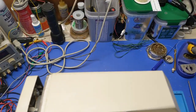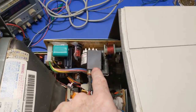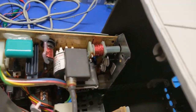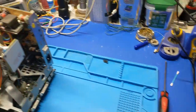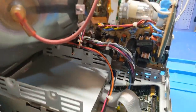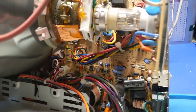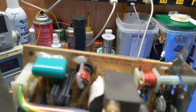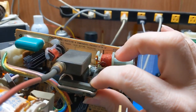Alright, so what do we have in here? It's in fairly good condition. This has the older flyback — unfortunately — so this is an early-run Classic. No surprise: we're missing the hard drive. It looks original though. The caps are original, the flyback does not have that glue on it that turns to crap, so that's a good thing. The core is not loose.